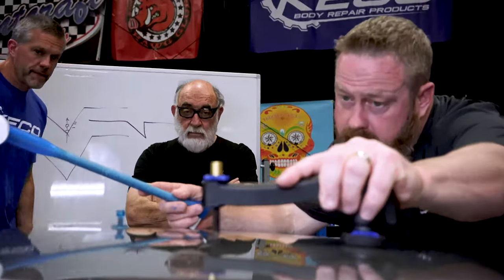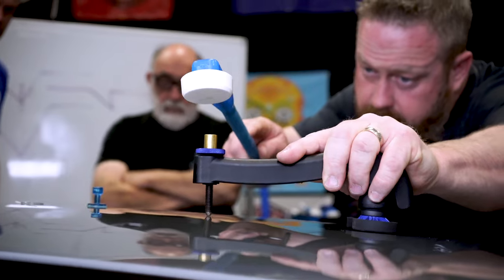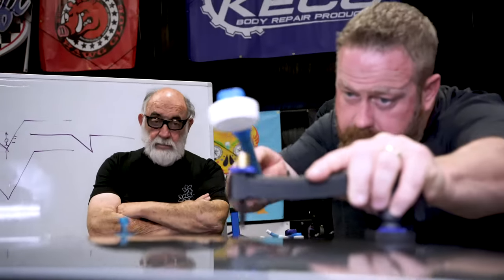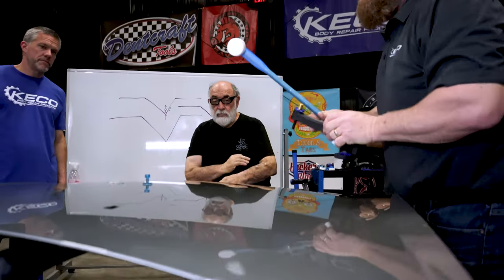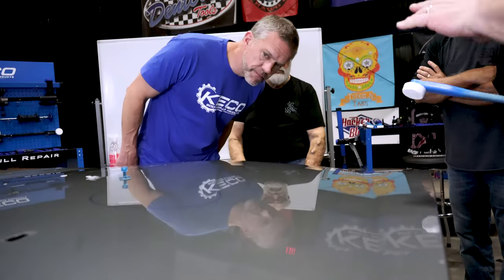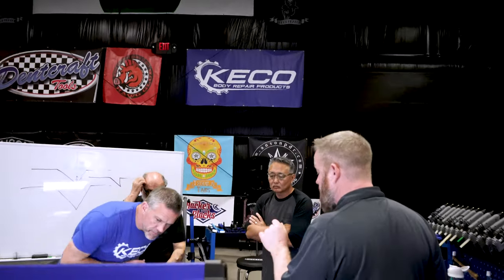So I'm going to come in here. Make sure we are straight down. Give it a little tap, and a little tap. To take this to paintless, I'm going to back my light up and I'm going to continue knocking down and get into real nuanced work.